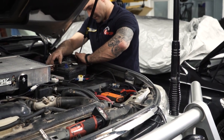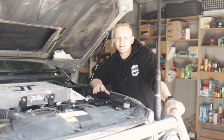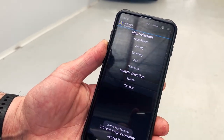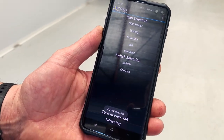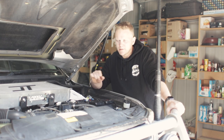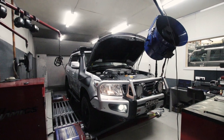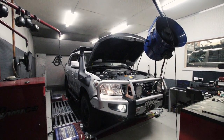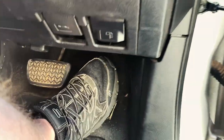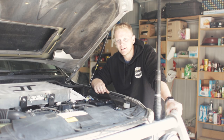Okay, now the Unichip X. The new Uni-X is 100% waterproof and dustproof, so it's identical to what the Safari is going to be there. Probably the main feature over the Safari that the Uni-X has is actually the Bluetooth connectivity for the map selection. You get the same five map selection as what you do with the Safari, but the Safari is only by a dash switch — I've actually opted for the switch for the Unichip as well, purely because I already had the hole in the dash and I wanted to fill it up. The Bluetooth module is pretty cool — you log in through your phone and you can change all the maps based on what you want: a power map, an economy map, an off-road map, another map. My fifth one is actually an immobilizer — if I put it onto number five, you can start the car but it's got no throttle whatsoever. It's a little bit of a fail safe, and with the Bluetooth version you can't get it out of that unless you Bluetooth app it and change it back to a drivable map.